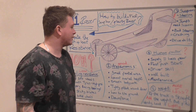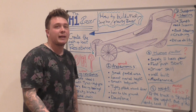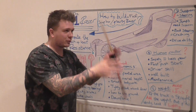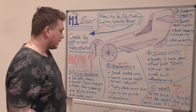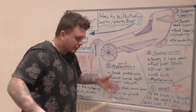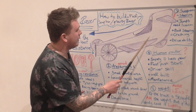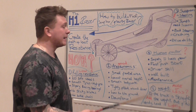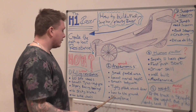The height limit for my soapbox race is 600mm from the floor, so that's what I'm aiming for. Smooth bodywork is essential — get a good paint job, polish it, sand it, make sure it's slippery, like the bobsleigh teams that buff up before a race. No jagged edges — you don't want to hurt anyone. It needs to be tightly fitted around the driver, keeping it small, tight, and low to the ground. A lower center of gravity is always better for any racing vehicle.